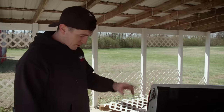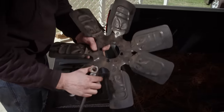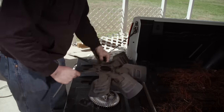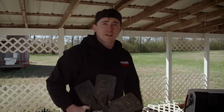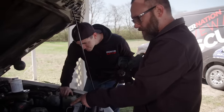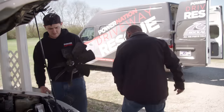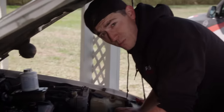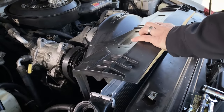While Mark's finishing up the radiator, I'm going to get the fan blades installed on this new clutch. If you're ever not sure which way your fan is supposed to go, just look at how it lines up with the fitment on the clutch and match up the bolts. With all the cooler lines attached, heater hose on, and lower hose already on and tight, we can reinstall the belt. With a belt like this, if you've got a pulley with a little extra room, always look straight down the belt and make sure it's riding straight. Then it's time for the upper shroud followed by the upper hose.